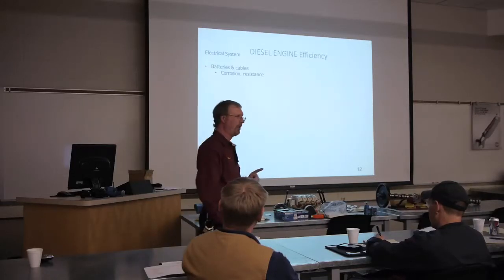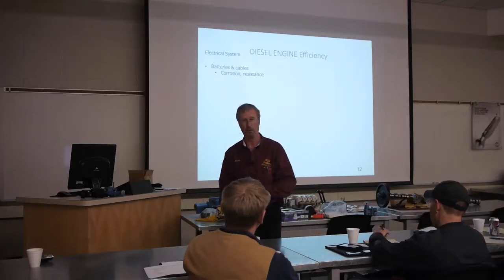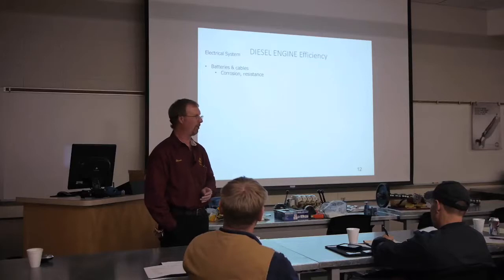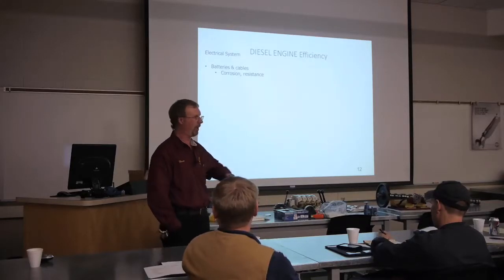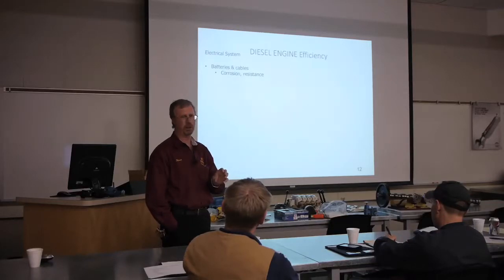The switch is not or should not be a load, all right? Because it's not doing any work. We want the light bulb to do all the work. We start pushing the current flow through there, we light it up, and we know we're working good. Those electrons go back home. The load is going to use up the voltage.